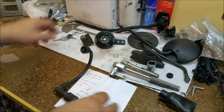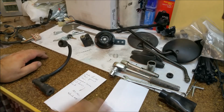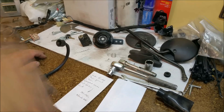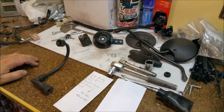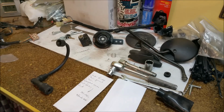And of course, then we've got a little list. Got to put that on again, a bit of Tie Shine, make it look good. And just do this. Whoops, 185 to 195 cc's of Honda ATF in the forks. Got some fork oil here. There should be enough in there. And just instrument wiring and warning lights, and I think we're pretty much out of it.